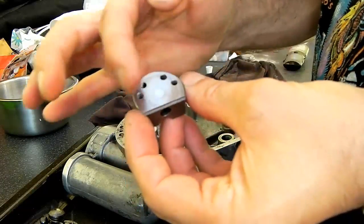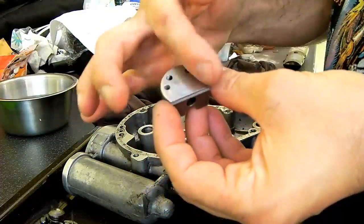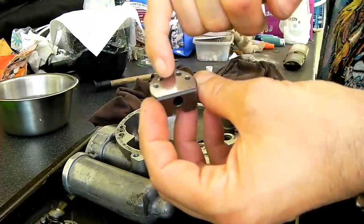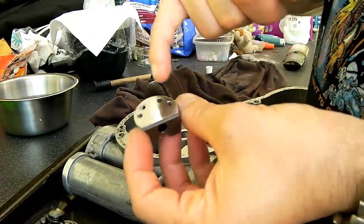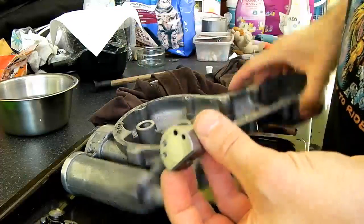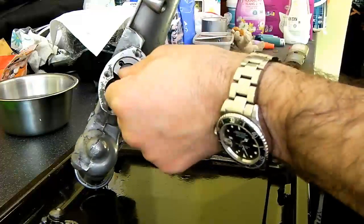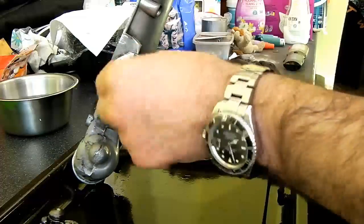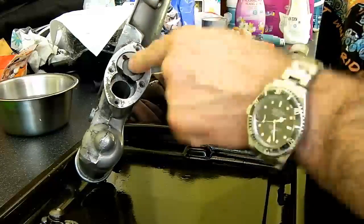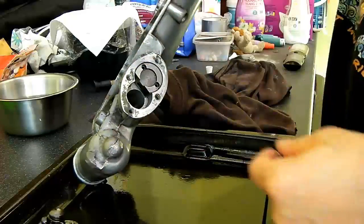Now with grinding paste, what it would do is give an overall sort of grey finish as you would get when lapping in a valve. Now obviously with the Autosol, what it's doing there is it's smoothing down the very, very fine milled grooves in there and achieving a nice smooth surface, and likewise in here as well, so that when this sits in here, especially once it's got oil flowing through, that will create a really nice tight seal, which will rock around on there and should allow more oil flow through suction and pumping the oil back through. It should give a greater flow of oil.